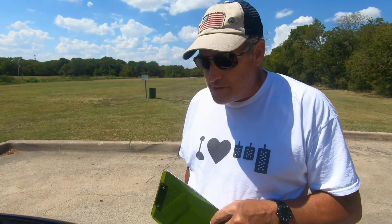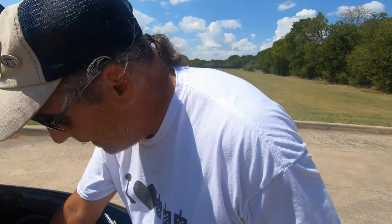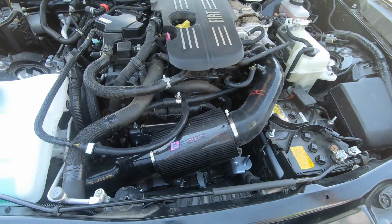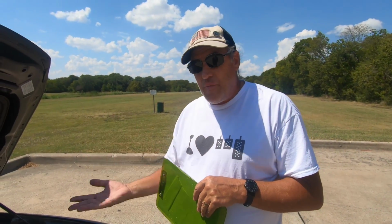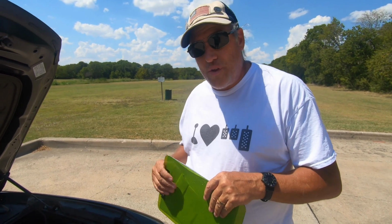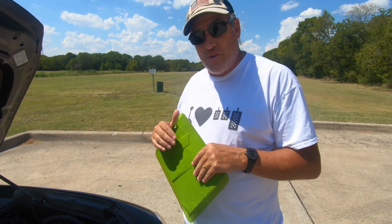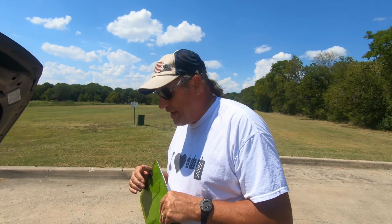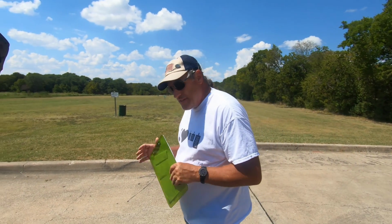What this does is it's basically a cold air intake. Silicone tubing, you've got a canister air filter, and it cools down. You can go to the Euro Compulsion site and see the data where they've tested how much it cools down the air going into the cold side of the turbo, and that does help performance. Colder air means better combustion. Overall, you get a little bit better power. Combine that with the next one, which is hard to see.